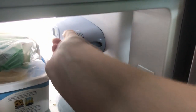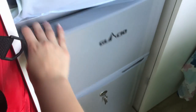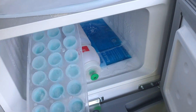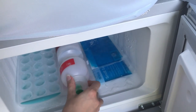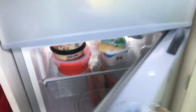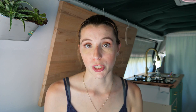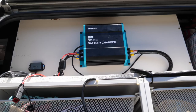The auto electrician diagnosed that the reason the fridge wasn't lasting more than one night was that the fridge setting was too cold. This is still a little bit of a mystery to me, because I could hear the fridge cycling on and off, and it's only rated at 5 amps per hour, so if it's cycling it should definitely last on my 120Ah battery — but for whatever reason it wasn't. Since turning it down about a week and a half ago, the fridge has not turned off. The auto electrician also installed my Renogy DC to DC charger, which means my van battery is now connected to my secondary battery as an alternate charging source if I'm not getting enough power through the solar.